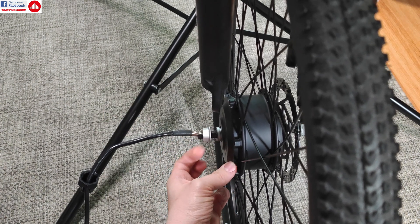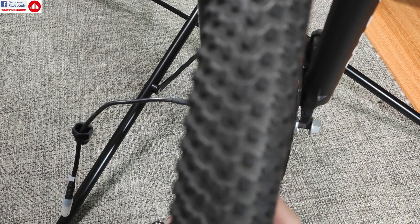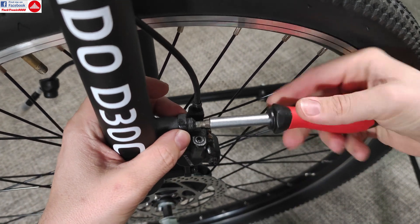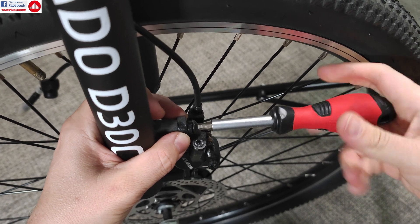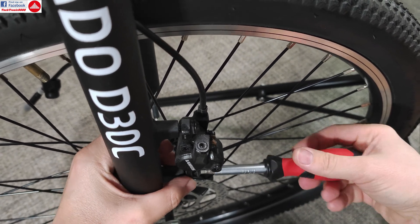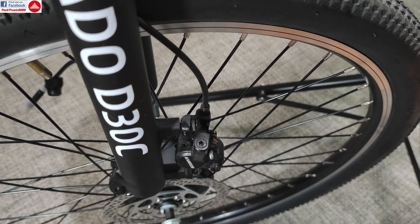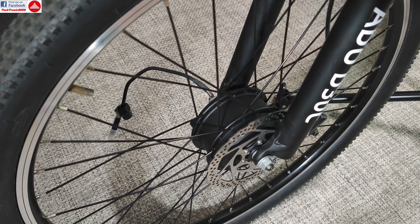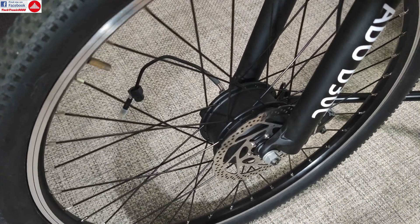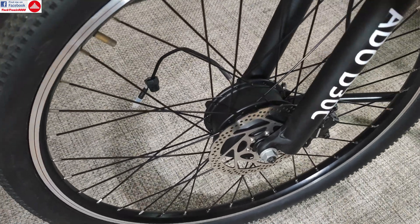The washers with the extra notch go downward as this will fit up into the front fork. To make installation a lot easier, I highly recommend taking off the brake caliper so we can fit it easily later — that allows us to insert the wheel with the disc more easily. If you don't want to take it off, you can leave it that way so the disc moves easily between the pads when inserting the wheel. This step might be a bit difficult but it gets easier if you put the bike down so the weight of the bike works together with you.